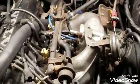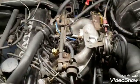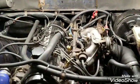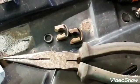It's real simple to swap injectors on a 240. There's like two bolts that hold the rail - one right there and one back there - and then there's one more holding the fuel pressure regulator, and that's about it. You just pop it up off of there, unplug your injector harness, and there's gonna be some little horseshoe style clips - just pop them right off.